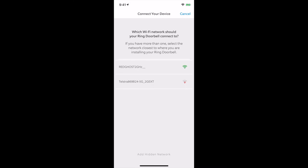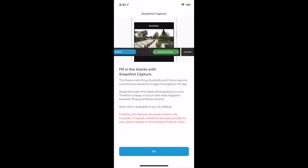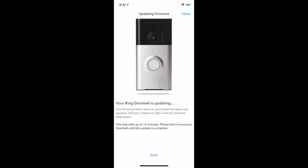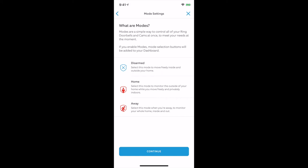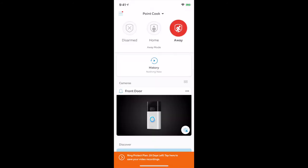Now select your Wi-Fi network — the network you want your Ring device connected to. Your Ring device is now connecting to your Wi-Fi network; this might take a moment. Now that it is connected to my Wi-Fi network, it's telling me that Snapshot Capture is going to be turned on by default — select OK. Congratulations, your Ring Doorbell is now set up and ready to use. Select Continue. We'll check the internet to make sure you're running the latest version — in this case, it's going to download and install the latest software, which can take up to 15 minutes.